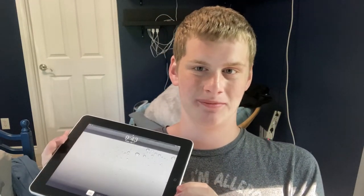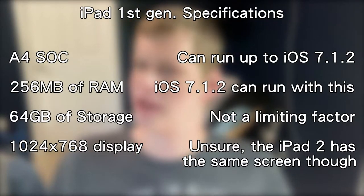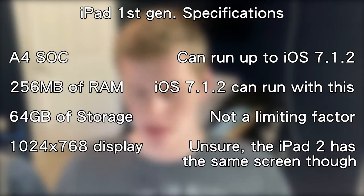This is an original iPad. The reason I bought this is to see — can I put iOS 7 on here? And the answer is yes, you can. While it has never been done before, technically it has all of the same specifications as the iPod Touch 4, with an A4 processor, different display, but that's fine. It has 256 megs of RAM like the iPod 4 does, and 64 gigabytes of storage. The problem is I've not gotten it to work. I've tried the dual boot method, which errors out before I can even boot iOS 7. Restoring through iTunes has given me no luck — I've gotten it to the Apple logo with a progress bar, but it doesn't get any further. I've been modifying IPSWs like crazy — probably 50 revisions — and they all do nothing.